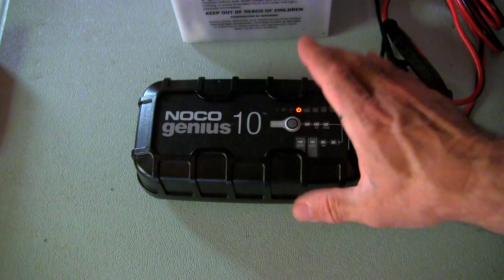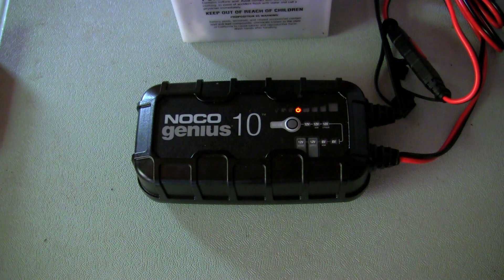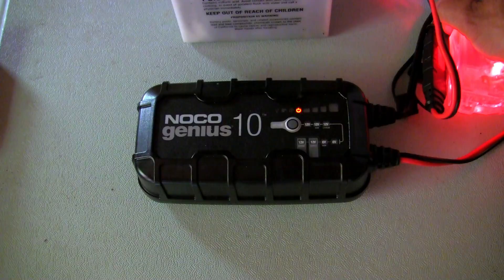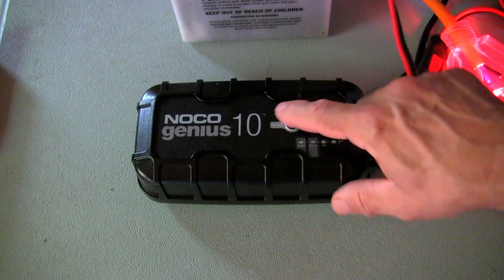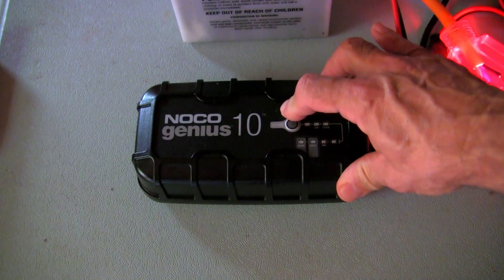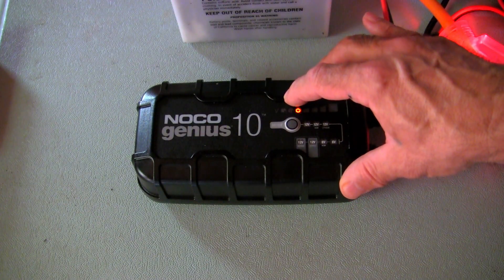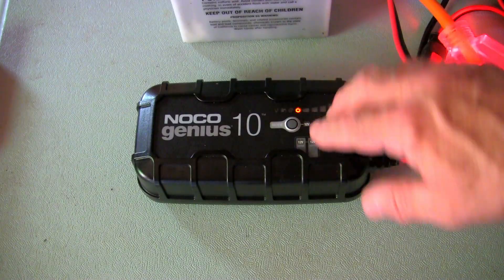I brought this inside because sunlight washes out the LEDs. There's one more set of LEDs to cover — the alert indicators. When you first power it up they all light up. The first one, which looks like a V with a lightning bolt, indicates over-voltage — for example, if you have it set to 6 volts on a 12-volt battery. The next is a bad battery error LED, which lights up for a short circuit, reverse polarity, or incorrect connection. The last is the standby LED, which stays constantly lit when plugged in and no active charging function is running.